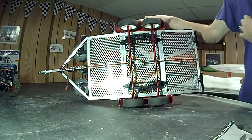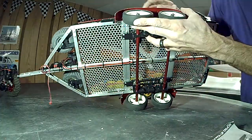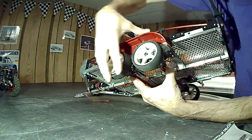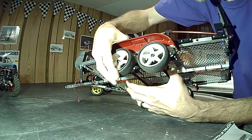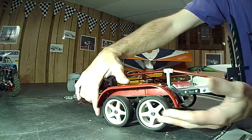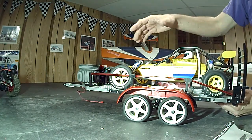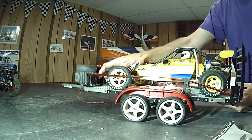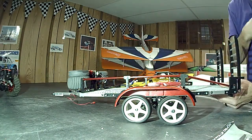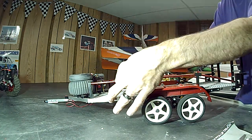A really cool feature is that it's an ultra-smooth, properly sprung dual axle trailer with independent dual links. These are dual parallel link suspension arms with built-in bump stops — up stops and down stops — and they're actually sprung properly. When you put the weight of a vehicle on it, it squats a little but also has room to travel. Going down trails or streets, this trailer just moves ever so perfectly. The suspension is very reactive — not like a leaf spring, which is way too stiff.